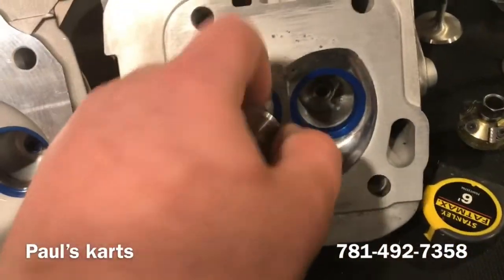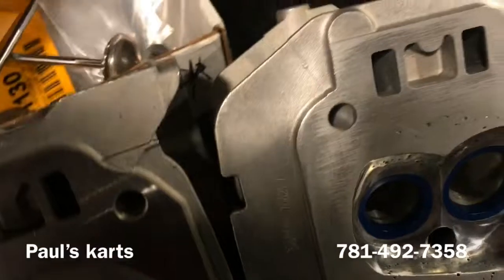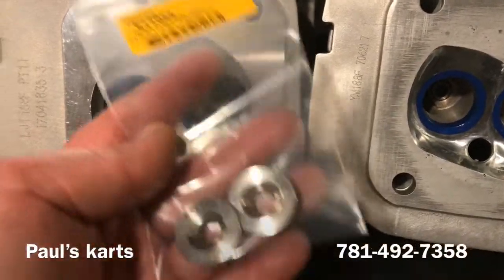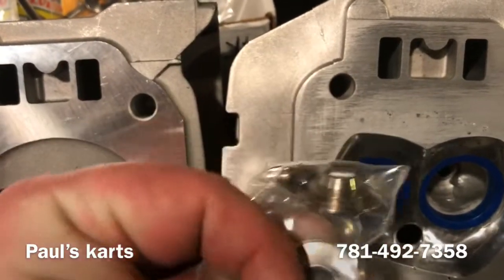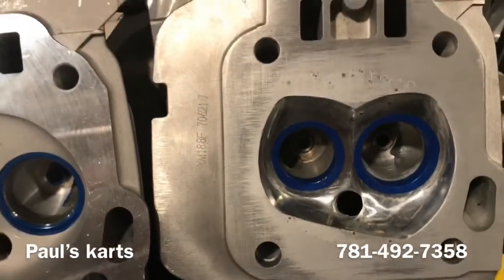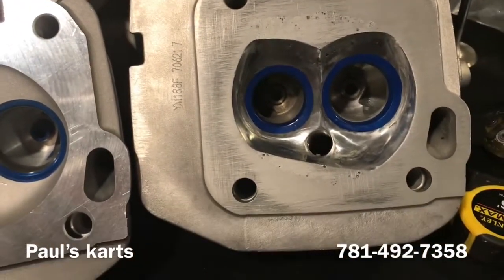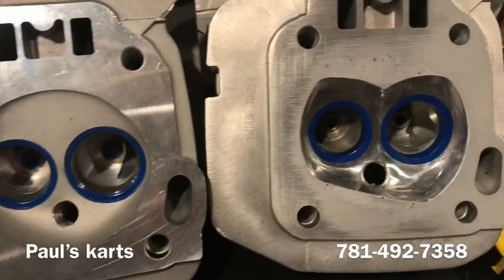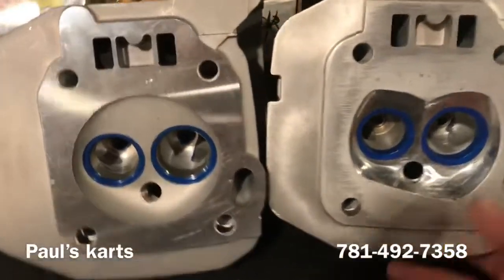This is a good-looking cylinder head for the stock-appearing class. This is going to be run with some titanium valve retainers — these are some that I have from Faraya that I run on the six-millimeter valves. Next step is to cut the five-angle valve job, do the porting, punch the guides out for the porting, do the five-angle valve job, put the guides back in, hone and size the guides. I set them at 1.2 thousandths — that way you get the best seal — and I use a 46-degree angle interference on the seats.